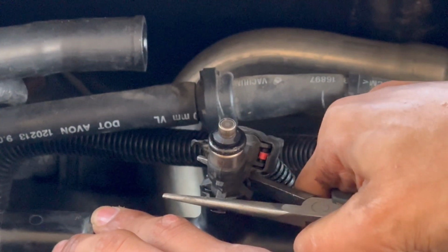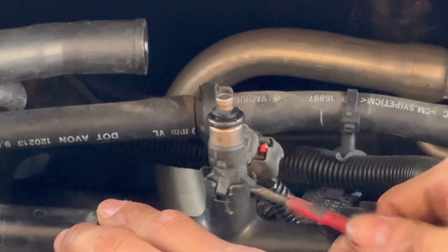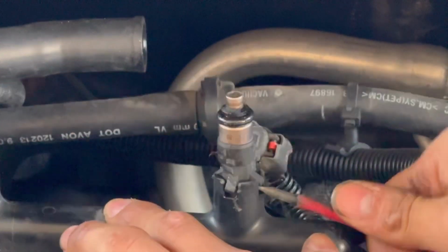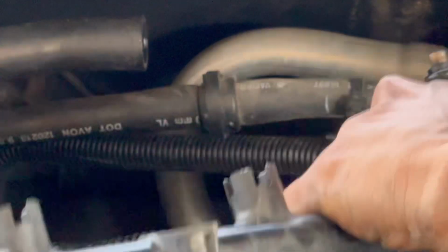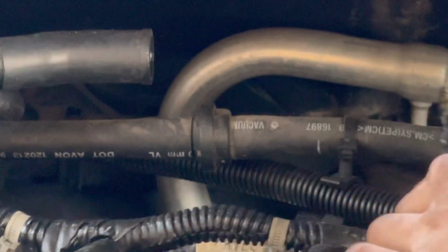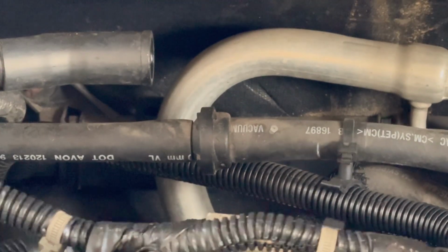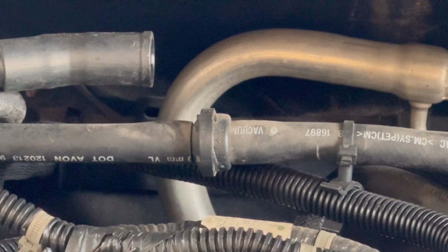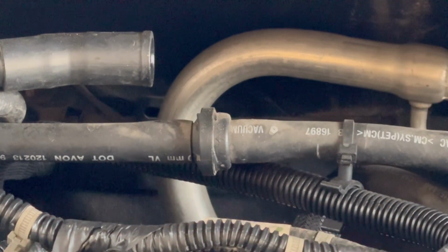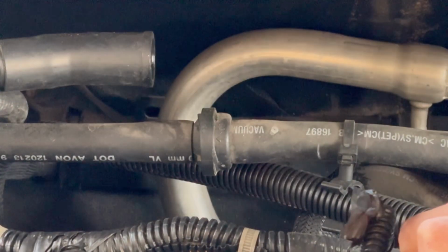Fuel injectors can be pretty tricky to take off. So you're gonna need to use pliers, screwdrivers, or whatever you can use. I'll just unplug the whole fuel rail like that to get more space. This one's tricky. I'm pretty sure it's not even gonna come off at all. I have to remove it. There we go.